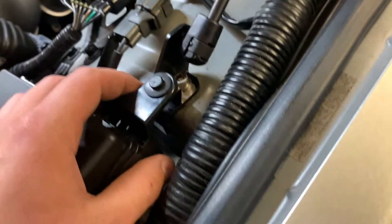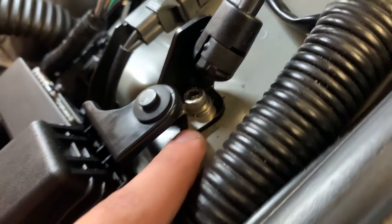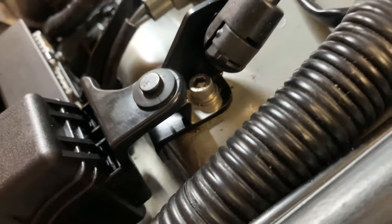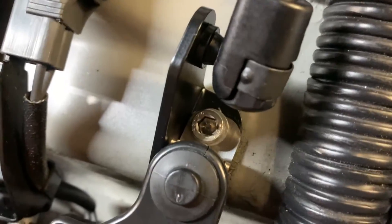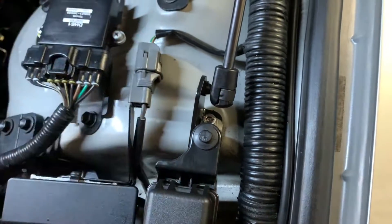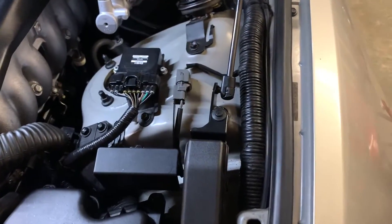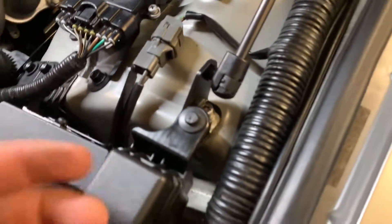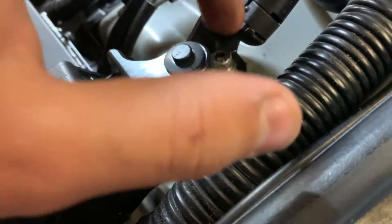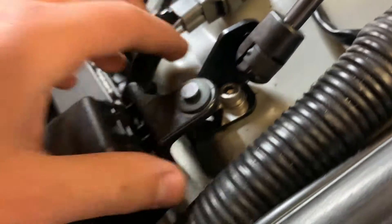Next, you're going to pull up on the relay box just a little and then you're going to get this little bracket — I believe this is an optional piece, but mine came with it. Out of the package you're also going to get an allen head key bolt along with a normal washer and a lock washer. I believe these brackets are the same left to right, but just make sure that the little ball end is pointing towards the outside of the vehicle on both the driver's side and the passenger side. Mount that up into the stock hole where that 10mm bolt went, put the bolt in, then get the push pin out of the package and put it through the relay box and into that little silver bracket.